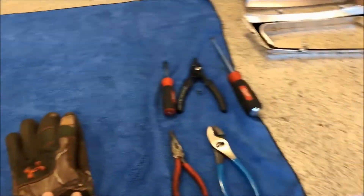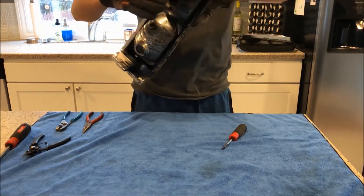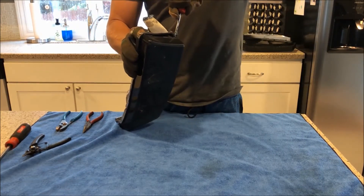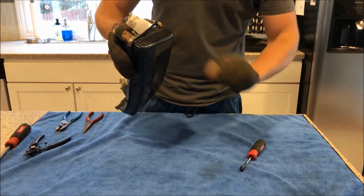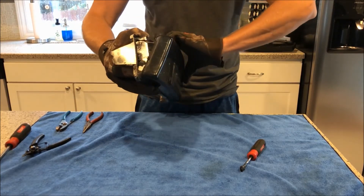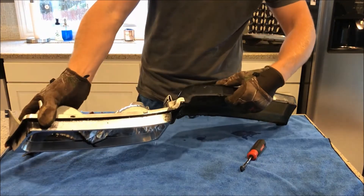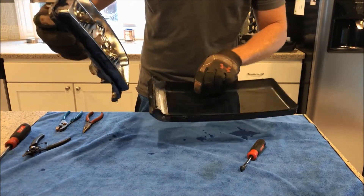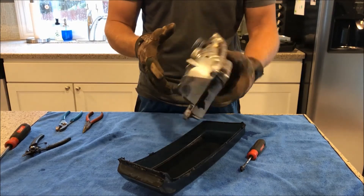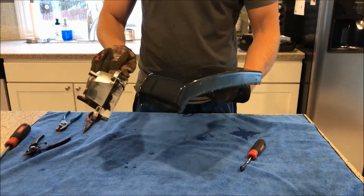We've got one more in the oven, and then here is the lower bumper light — it's basically the exact same procedure. Just stick the screwdriver in here, it's real soft and these come apart super easy. Just pry in there, get it to a point where you can get your hands in there, and then just pull it apart. You can see these actually had a little bit of condensation in them — pour that out. This part is all one molding, so there's nothing to take apart on either part of it.